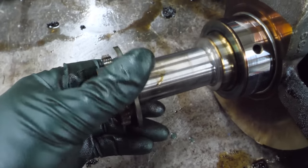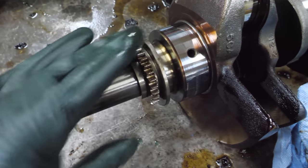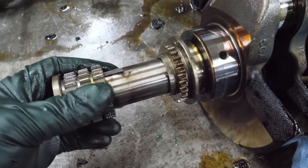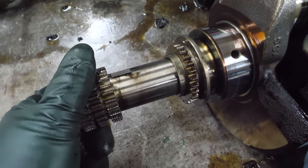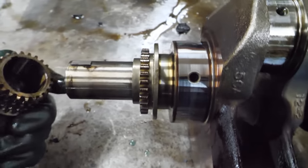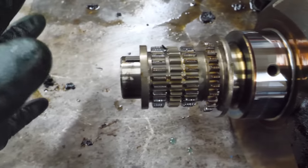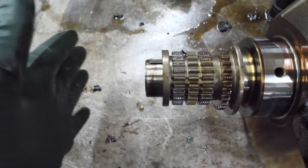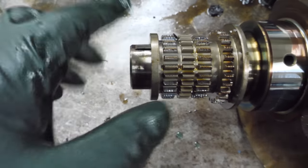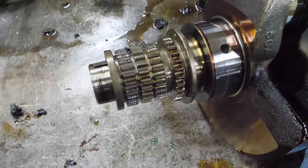In one position it slides past it. And then it rotates freely. When I pulled the last VR30 apart, everyone jumped onto the bandwagon of that's why the engine was bad. But what happens is that I can't get this on here. That's what happens. This slides on. And then your crank pulley sits on top of this, and the bolt sandwiches everything together. That way, this is still keyed from the keyway, and this is set with friction. And that's how that doesn't spin on the crank.